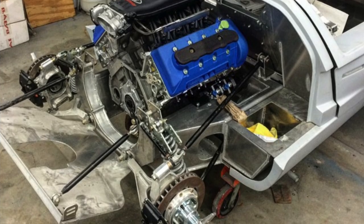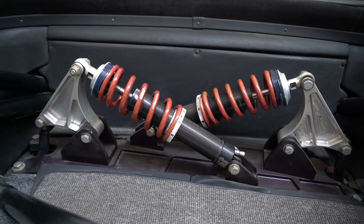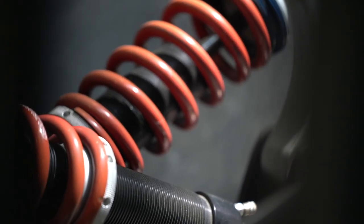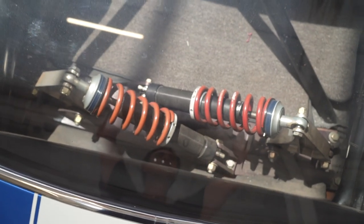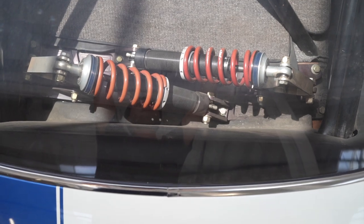I love that you're using DSE — they're the quality, the hydroform. It's got a cast aluminum K-member like nobody else is doing that. So now since we've gotten onto suspension, what did you do back here? The rear suspension is a torque arm. It's been through various design iterations over the years. It came from Mike Meyer and it's his original design with cantilevered shocks. When he drew up the suspension, he didn't think there was enough room to package a long enough shock with a good motion ratio for controlling the wheels.